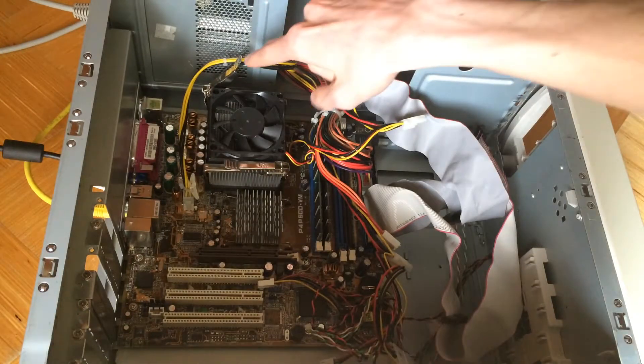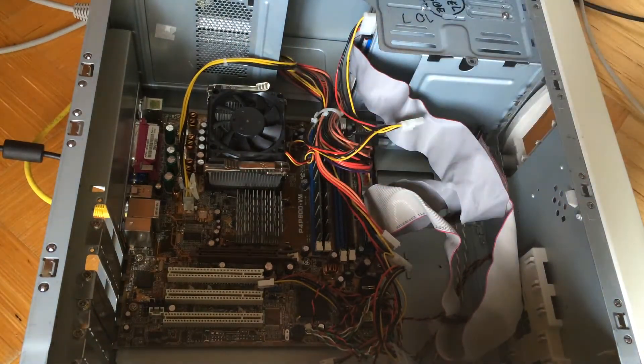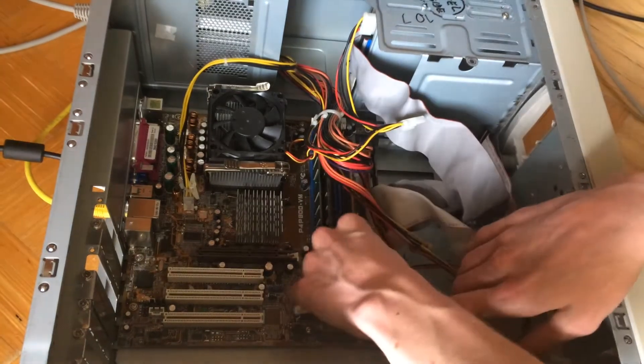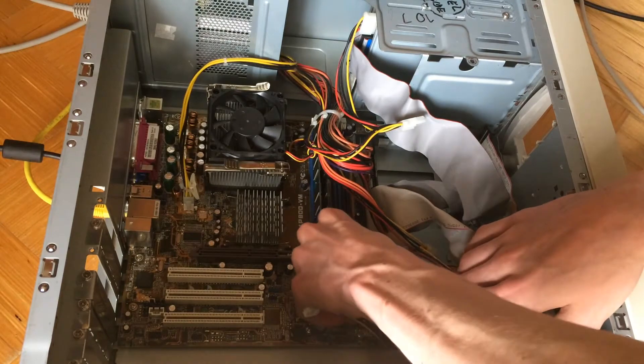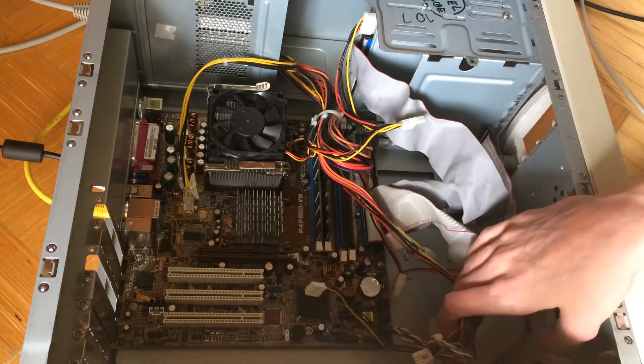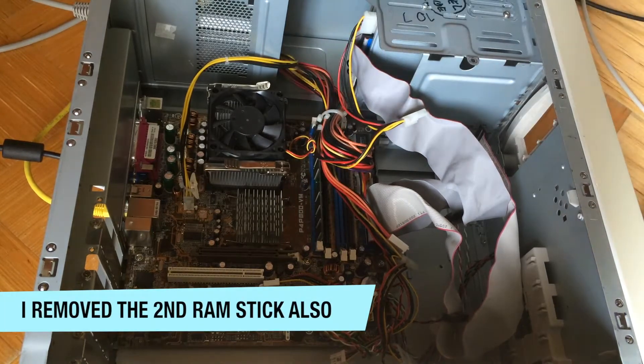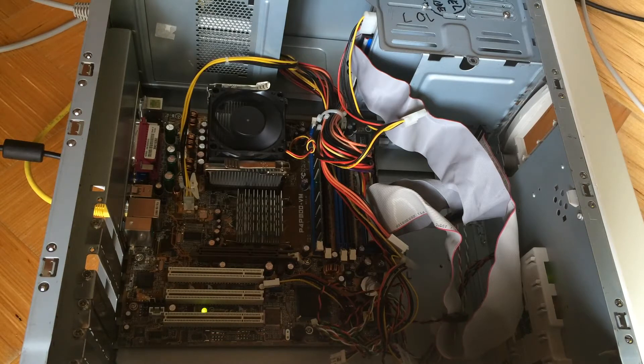Final step on the CPU cooler — push that down. I applied some new thermal paste; it was unfortunately the last I had, so it might be a little bit less than needed. It won't run too much anyway. Now the battery is back in. Power on. RAM is, I believe, in properly. Let's see if it boots. Doesn't look so...